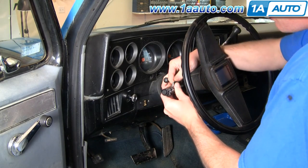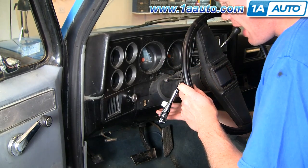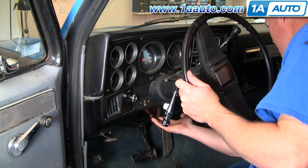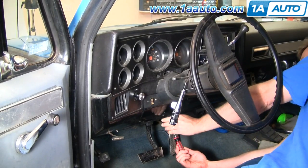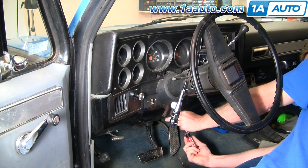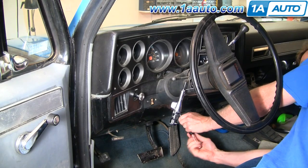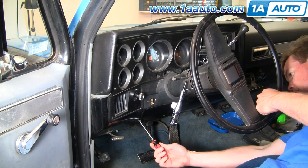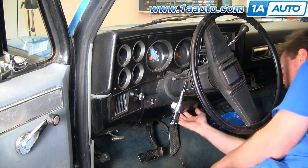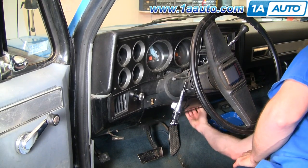To replace this stock, you basically just pull out firmly and then leave it right here. What you need to do now is find the other end of this wire underneath the dash. On this truck I'm going to take out three screws — this part will differ depending on your vehicle. If you don't have AC you can probably find this wire pretty easily, but this truck has AC so I have to take out the lower AC duct. I took out one screw and I'm loosening up two others, then the AC duct just pulls right out.